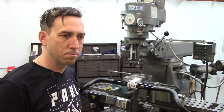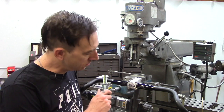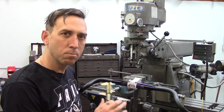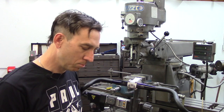If this was a carbon fiber handlebar, you could maybe see some cracking at this point — very bad. So while this does distribute force very evenly across the handlebar more than most stems, this is where you start to see the bar change shape a little bit, at eight Newton meters.